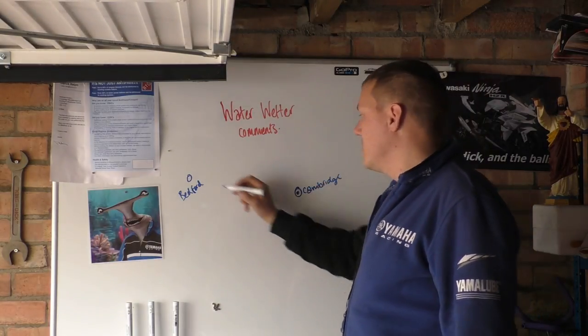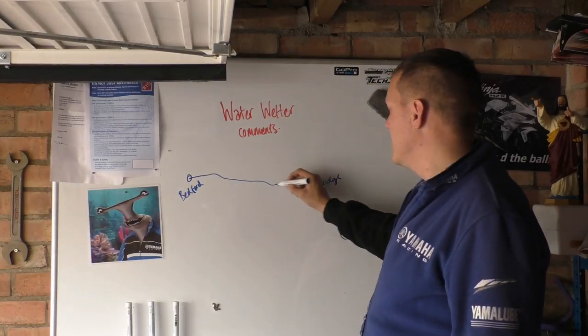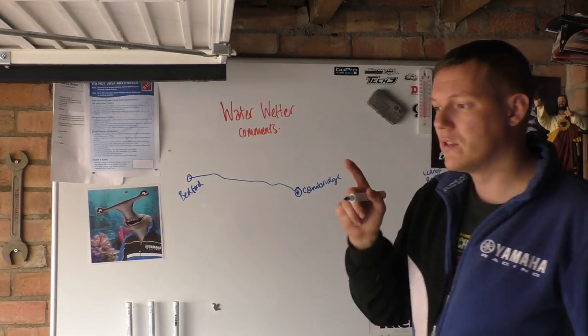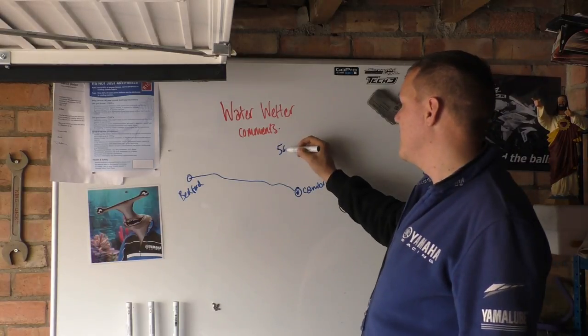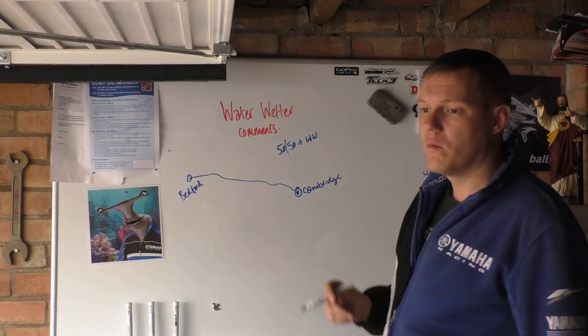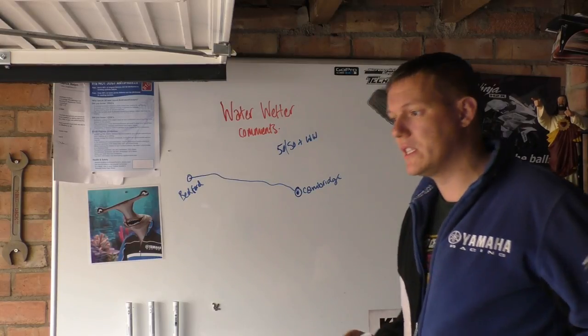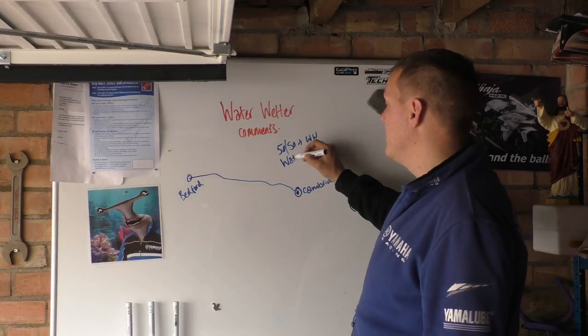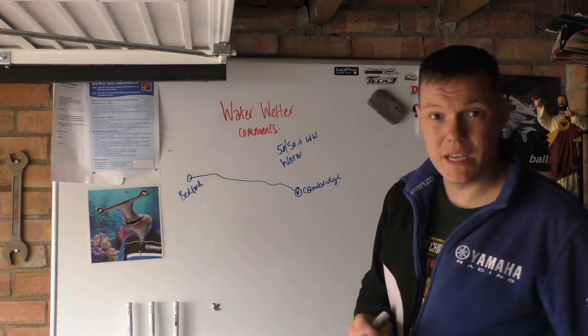So what I'm going to do is ride up to Bedford and back, and we're going to log the temperature. We'll do that with what it's got now, which is 50-50 plus water wetter. We're then also going to drop the system, flush it out with water, and use water only, and we'll do that same run.